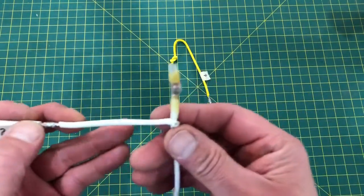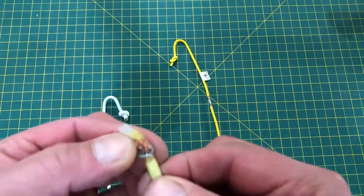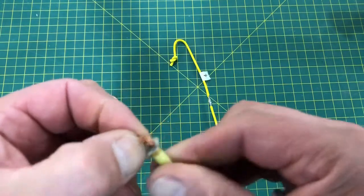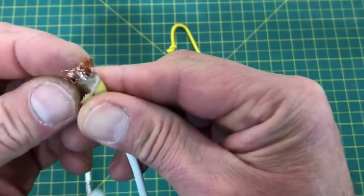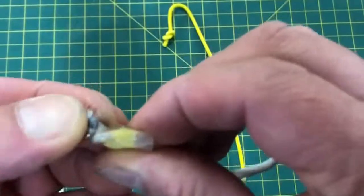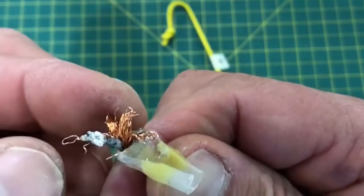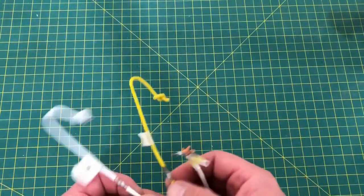On the 12 gauge wire here, you can see it is the same basic thing as the others. And it took even more force to break this. Well, actually, maybe it didn't. It wasn't as much as I thought for the 12 gauge wire. But again, it's really the solder that didn't penetrate all the way through. And maybe that's just a characteristic of this low temperature solder that you can use a heat gun for. It doesn't flow as good and penetrate in. Well, I don't know if I need to say anything more about that.